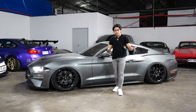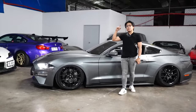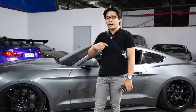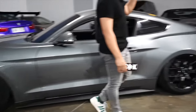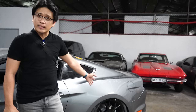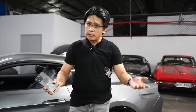Hello and welcome to the final thoughts of this video for the Ford Mustang Mark VI. Quick summary: on the front, we changed from a stock shock mount bearing to a customized shock bearing for air suspension — that's the major change up front. On the back, we converted from a double bellow to a triple bellow bag — that's the significant change from the last catalog video. And for the system in the back, we went from Gen 1 to Gen 4, and from the top flooring down to the spare tire area. Ford Mustang doesn't have a spare tire, so it's a perfect placement.